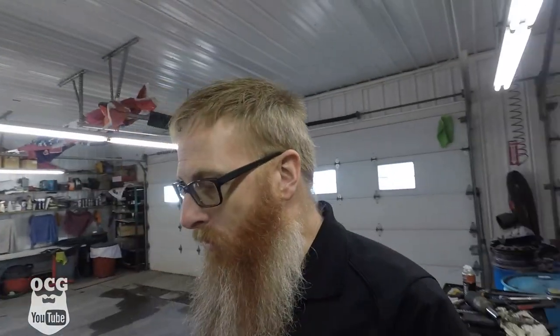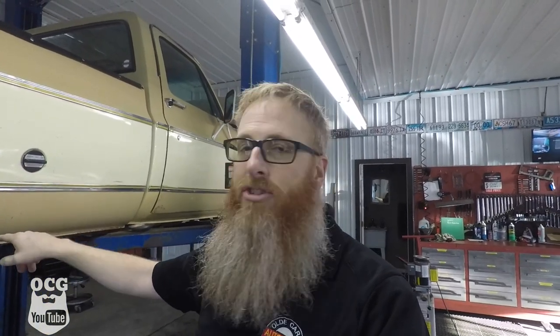We are trying to get this up. After working on it for about two hours yesterday, we determined that we think the spring on the passenger side rear, being original, is weak — weaker than the driver's side — and it's causing this back right corner to sag a little bit more than the other side. So no matter what we do to manipulate that front spring hanger, it's not changing a whole lot. What we did do is change just this one bracket at one point, set the truck down, and it lifted up this corner, which in turn put the front driver's side down and almost leveled the entire truck.